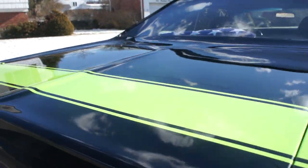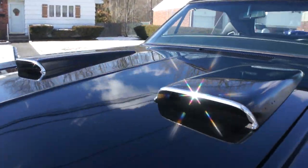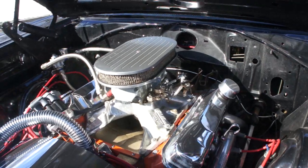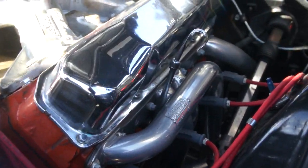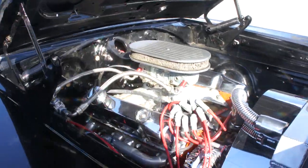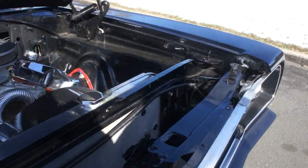Body's super straight, guys. Trunk extension. Check out the end of the hood. It's the 440, '69, 30 over. Like I said, everything's brand new. It's got a radiator — runs nice and cool, around 170 degrees all day long with the shroud. It's got dual feeds in case I want to do dual quads — I have a separate hood for that. I don't want to cut this Ram Charger hood. It's like almost a dinosaur — it doesn't exist. You cannot even find them.